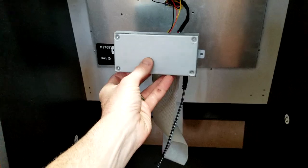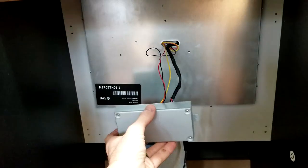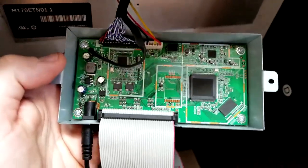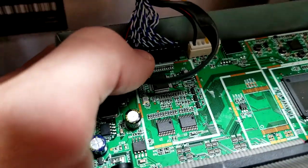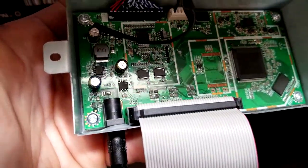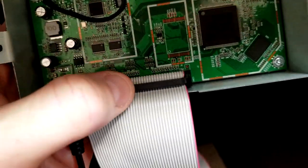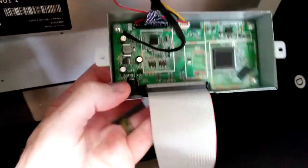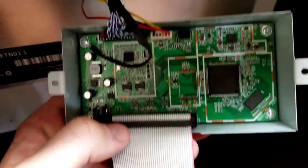This board here will be mounted up here. There are two screws right here and then the cords just go into cord management. What you want to do is flip it around to see the bad PCB board. We're going to have to remove this pin up here, that white one right there, and we're going to have to also remove that screw, ease up on this right here, and this obviously just unplugs from the power cord. These are pretty easy to get up — you're just going to inch them up; just don't yank at them.